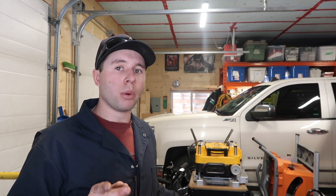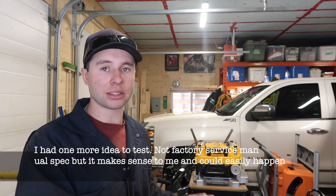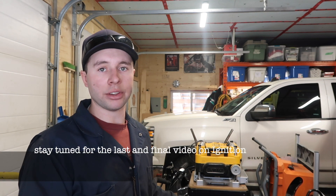Alright guys, thanks for watching. That's how to diagnose the CDI on a King Quad 300 — basically test everything around it. You're probably only going to have maybe an hour into testing all your electrical components, and if they all pass, you know that your CDI is in the middle of it and that's going to be your issue. That pretty well covers our King Quad 300 ignition testing videos. I'm going to do some more videos on how to test other electrical stuff, and one more video just to isolate the CDI in case you still don't have spark due to other issues.